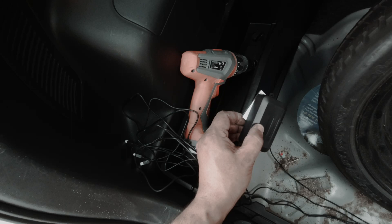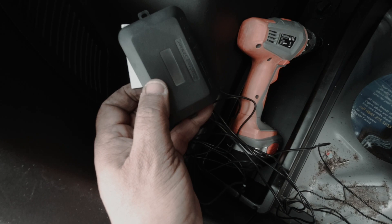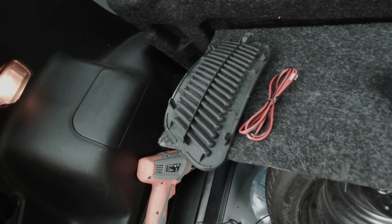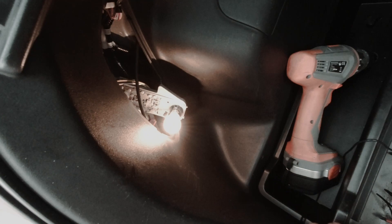We're going to put the controller box on the left-hand side on this Toyota Yaris, and I'll assume the wiring is in this little box on the side. As suspected, I take this little panel off and that gives me access to the cabling for the rear light cluster — that's where we apply the power cable to the reverse light. I've put the car in reverse to make it easier to identify which bulb is the reverse bulb.